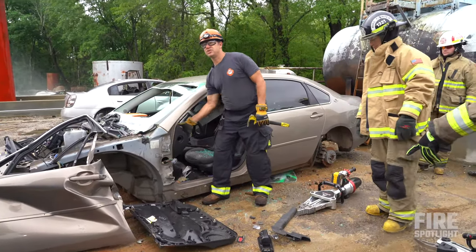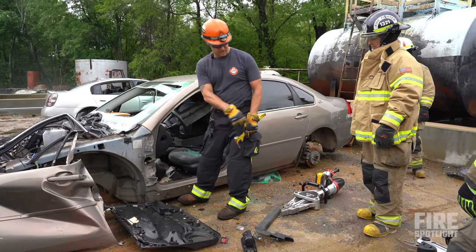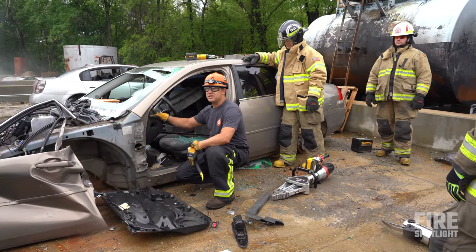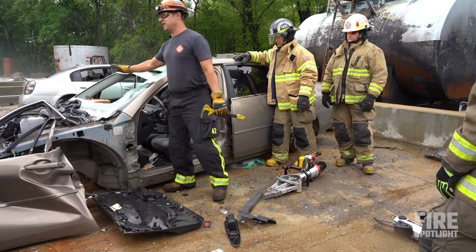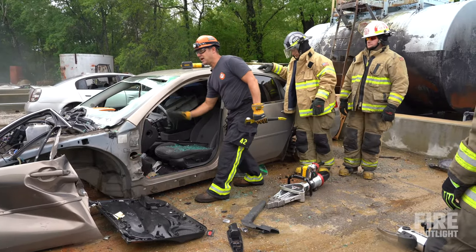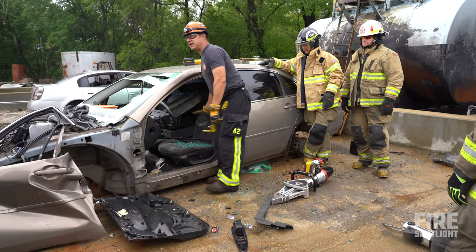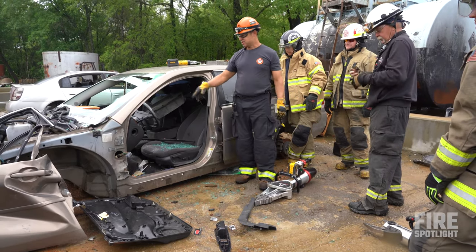Steve's going to do a cut with the Sawzall just to show you the transverse beam — there's a transverse beam that runs from here to there on every single one of these vehicles. Without cutting it with the Sawzall, we could use the spreaders and the extended reach tips right here. We're going to make about a 45-degree angle from here underneath this dash. With the correct angle you can blindly spread into this dash and you'll more likely hit it. Once we hit that transverse bar, this steering wheel should be sitting around this area. With the extended reach tips and the spreader, when we spread from here to here it opens this up and you have all this room to get in and pull your patient out.